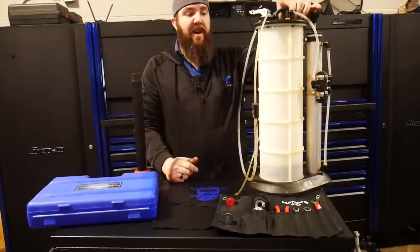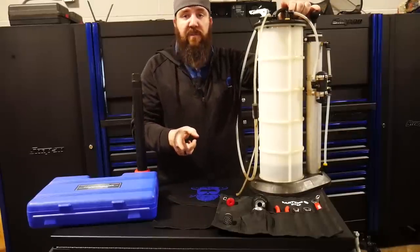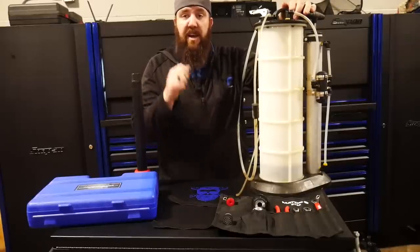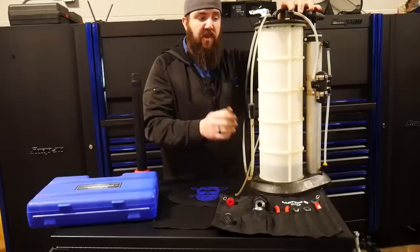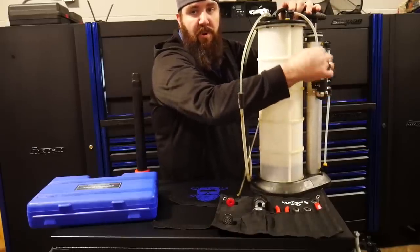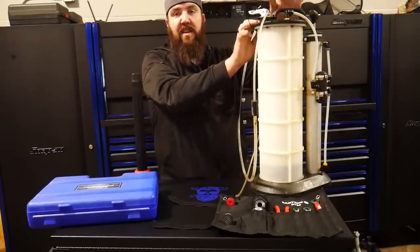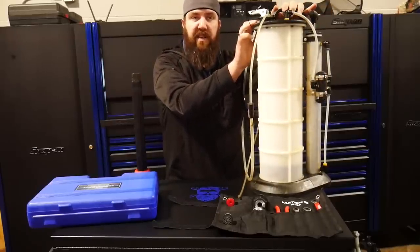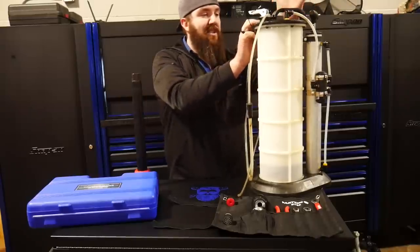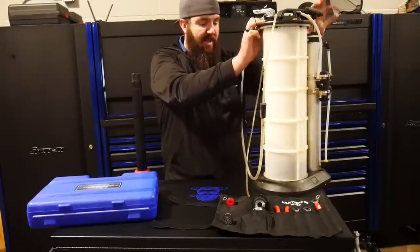The cool thing also about it is that it does both suction and it puts fluid in. So if you've got a differential that's in a hard place to get and you can't put another fluid insertion tool, this works great for that. All you have to do is use the little plunger right here on the side. You just push or pull up on it — it changes it from suction to pressure, and it is hand operated. They do have one that is the 7300 model, I believe, that is able to hook to shop air. This one, just for dragging it all around the shop, is just hand pump right there.